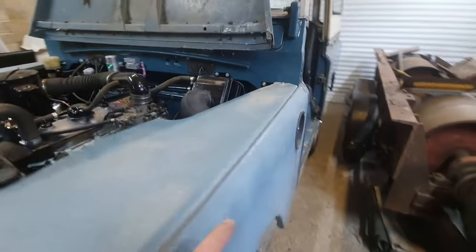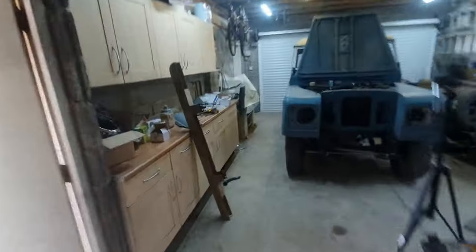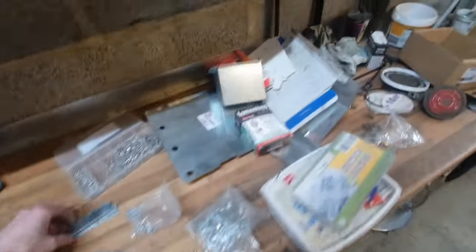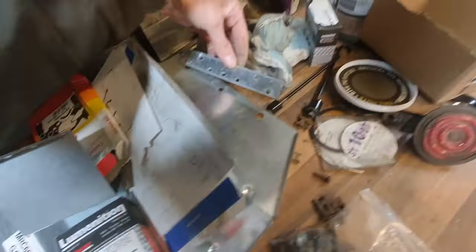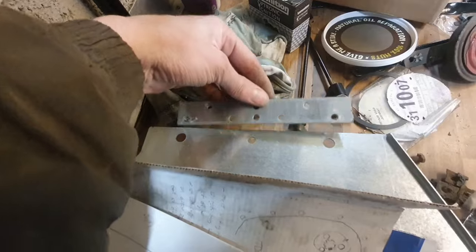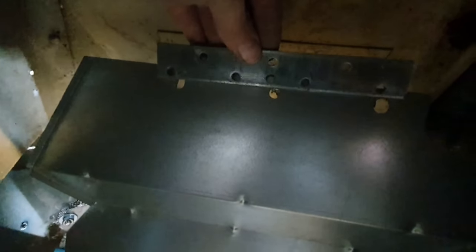I've realised I've got to do these panels first - the ones that go up under here. There's the panel. I've got these loosely in, and then there's these up here. As you can see, the aluminium plate that holds to the wing itself is a bit crusty. All the bolt holes are missing. So I've come up with an idea - some leftover material that just happened to have the right spacing. I've widened the hole to 7mm, drilled an extra hole, and the spacing is pretty good - matches the spacing on the top there.